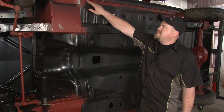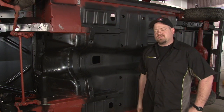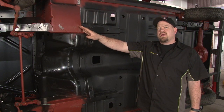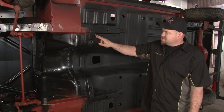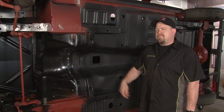From the factory, our Mustang would have had seam sealer all the way down this rocker edge here, around the torque boxes, and into the edge of the rear floors up front. Since we added torque boxes in front of our Mustang for increased support, we're actually going to seam seal this whole area. We'll use the larger seam sealer for all of this and the brushable for the smaller sections here. You can also seam seal anywhere you have metal overlapping each other — it wasn't done that way from the factory, but if you're building your car and you're going to drive it, it's not a bad idea.